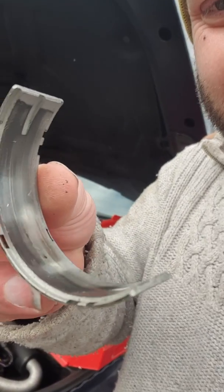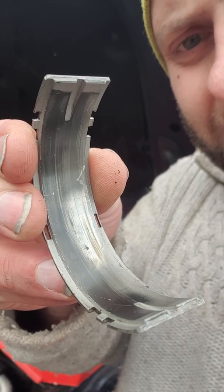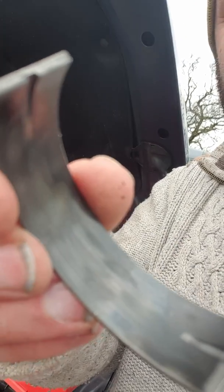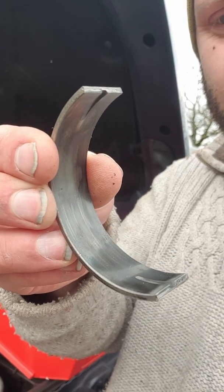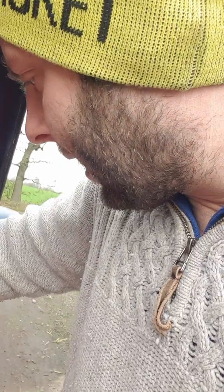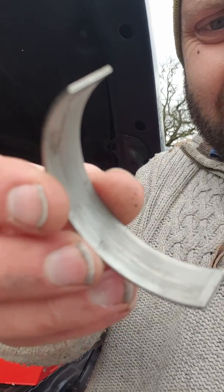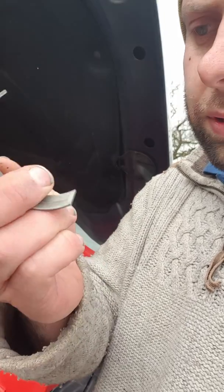So that's actually one of the worst. You can see he's taken off the top coating. These are two main shells. You can see it's got a bit of a hot spot on it and the white metal's gone. And then a big end — I did the big ends whilst I was there. See that one looks — it looks worse on there than it actually is.